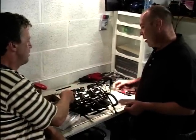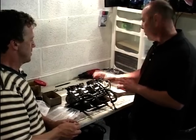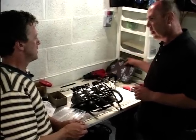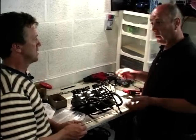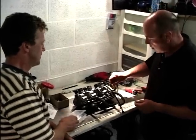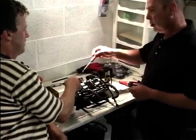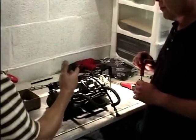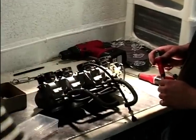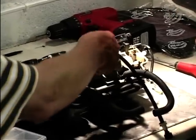What's this anyway? Blackbird — this is off a Blackbird. Now, I will be putting some cans on it and I'm also going to put a high performance K&N filter on it as well. So what we need to do is fit the 155s. Which is what I'm doing at this moment. It's basically four times repetition on a four-cylinder bike — once you've done one, they're all the same. No difference.